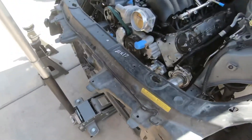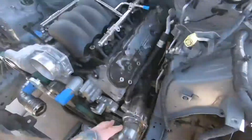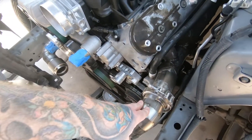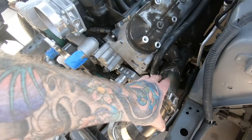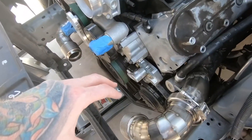Kind of got a plan with fuel. Changing up the hot side as well — I've got the radiator support in, which I'm gonna chop up, extend out, and push the radiator and the intercooler back further. On this side of the exhaust, I want to route it down through there, come up through the bottom — that'll free up this whole area for the turbo. Once I get the shifter relocation off, I'm gonna toy around with some things, hack it up, and see what I can do.